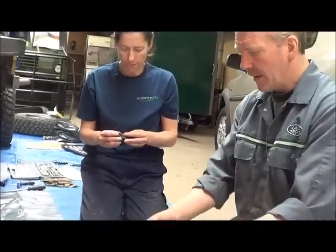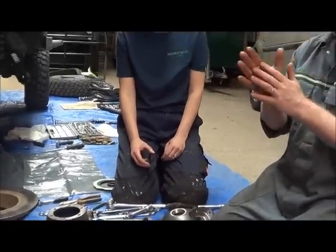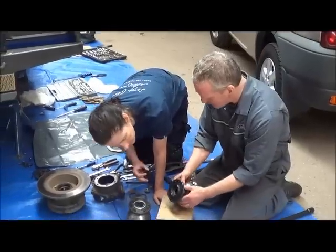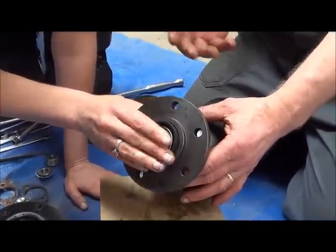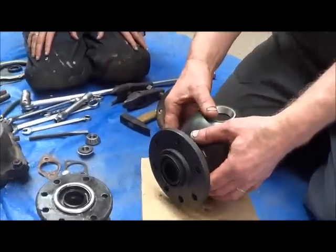When you check the oil in the differential on the Land Rovers, quite often you see that the oil has gone from being that nice yellow clear colour to a sort of grey liquid, and that's because that seal, which is here, is no longer working. So the grease is transferring that way and the oil is transferring that way. So they're mixing. And also...